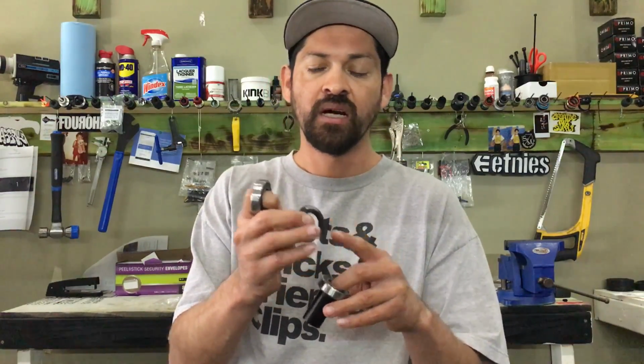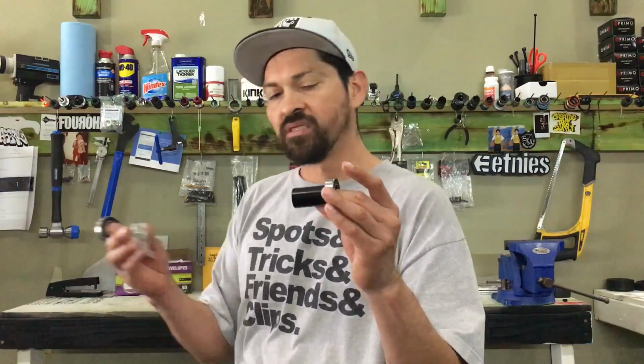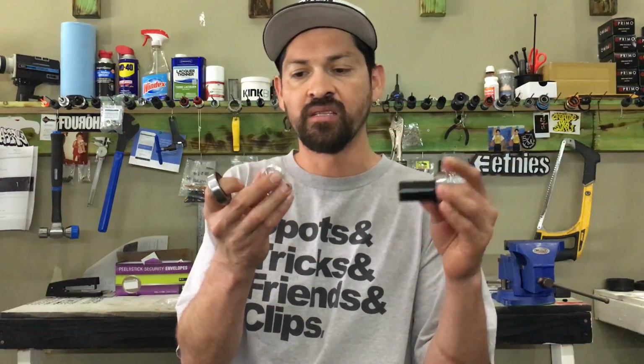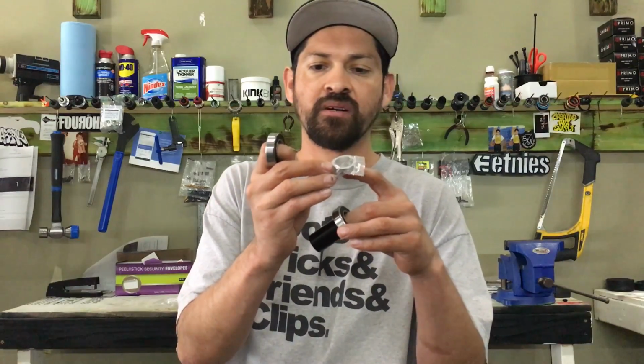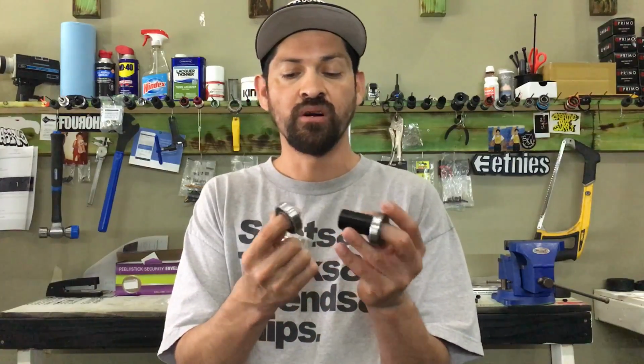They got some pretty cool cone spacers. They got solid bearings. They got a tube spacer, and the tube spacer is pretty small, so that you could add these spacers if you need to. It's got plenty of spindle spacers so that you can adjust and change your actual bottom bracket to fit your special needs. All cranks are different. You're gonna need a change, and there's not always a norm. You don't always need this one for every single frame. You don't always need X amount of spacers for your certain cranks and sprocket and so on and so on and so on. Everything is custom.